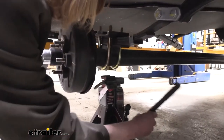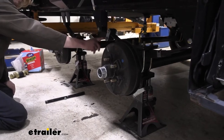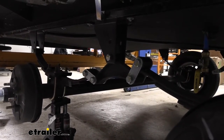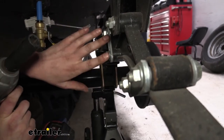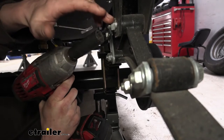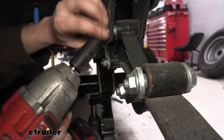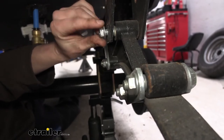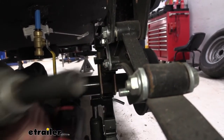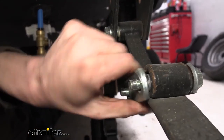Now that we've got both jacks set up, we're ready to start removing our hardware. All of our bolt heads are on one side, so we're going to be on the other side to remove the nuts. If you've got a creeper, grab one because it's easier laying underneath. These are the nuts on the back side of our equalizer — we're going to remove all five using an 11/16 socket. A good impact should zip these right off, but if you don't have one, grab your breaker bar. The middle one, after we remove it, we're actually going to thread it back on just a couple of turns.